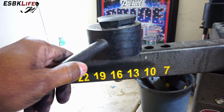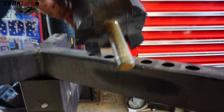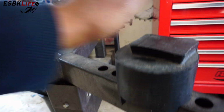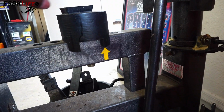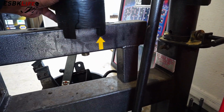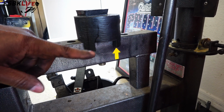This one has an adjustment arm so it spins, but the other ones lock in place. You can see the blocking plates that keep them locked into place so they don't move. On the side here, there's an arrow. That arrow corresponds to where this block should be when you're going to deflate the tire. So what we want to do is break the tire bead from the wheel.